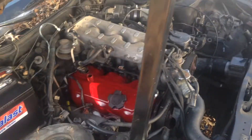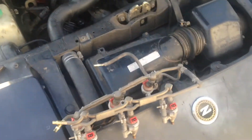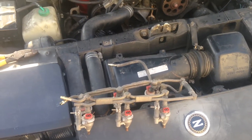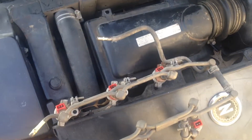I don't have to put any resistors on. So this is what they're talking about — this is where you want to convert from, but for the time being I'm going to convert to these. These are the dual slash side-feed injectors. There's not many possibilities when you go to upgrade from these — not a lot of people use them. Actually since mine is an 85, it has a regular fuel rail, the first edition I guess. So those rails are the ones I can use when I go to upgrade injectors.